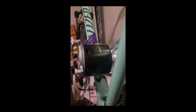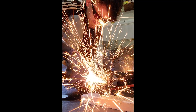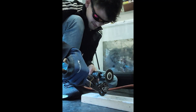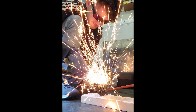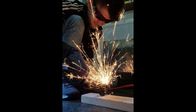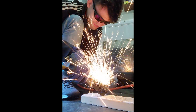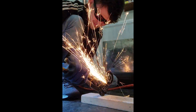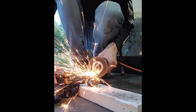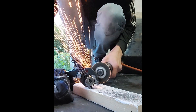The first task of course was getting a really good strong drive gear for the whole system. Because I'm still using the rear derailleur, I needed to fit the chain, which required me shaving this one down by about half as it was too thick. Other than that it fit great. And this drive gear has to be strong because it's going to be handling 25 foot-pounds of torque, which is a lot considering a person does about 80 but with a much larger gear.